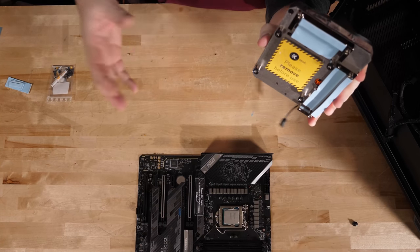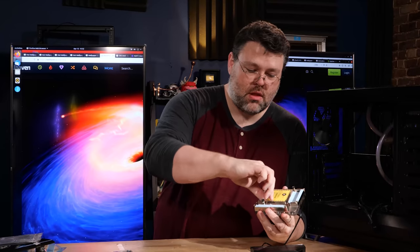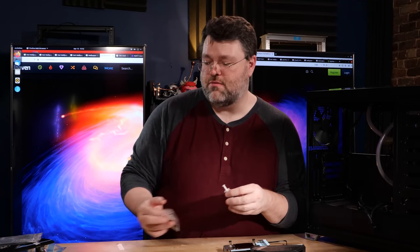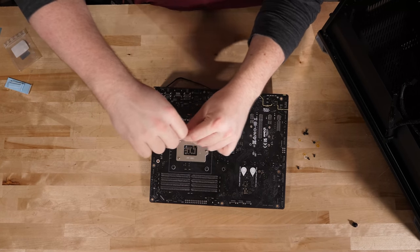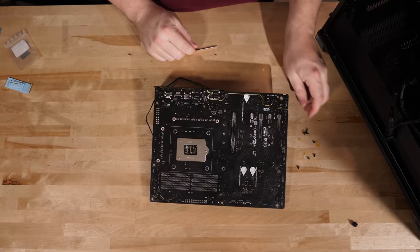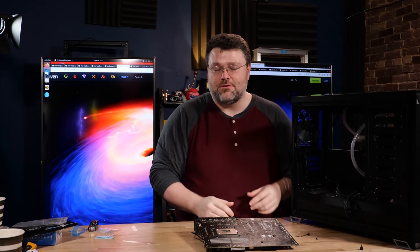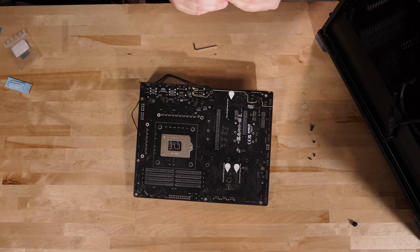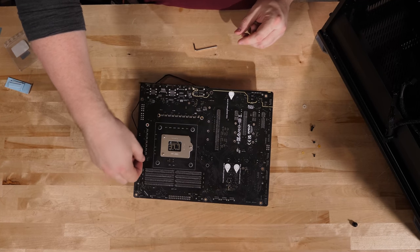One side of the thermal pad is more sticky than the other. I usually put the sticky side against the metal so that if I ever lift it off, the pads come with the heat sink rather than staying on the VRMs. Be sure to remove the 'please remove' sticker before use, and use the EK-included Ectotherm — such a cool name for thermal paste. As you tighten the monoblock, be careful not to over-tighten, and tighten from corner to corner so that you get approximately the same torque in each corner, ensuring the heat sink goes evenly onto the CPU heat spreader. You've also got four screws that connect to the VRM area — tighten those gently too, making sure the monoblock makes good contact with both the chokes and VRM componentry, otherwise it will fail catastrophically and the magic smoke will escape.